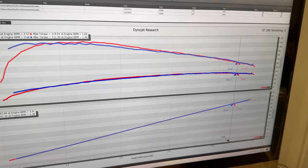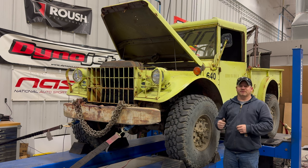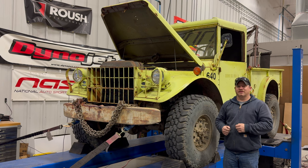Boy, that would really transform this truck. So it looks like the first project for this winter on the M37 is to give it an ignition upgrade. I'll probably go to an electronic ignition — that way I don't have to worry about points. That will be especially useful on an off-road vehicle like this where it could see a lot of water and dust. After I do the ignition upgrade, I'll probably put it back on the dyno and test it again, and see what difference it made. If you want to see more videos like this, comment below and click subscribe.